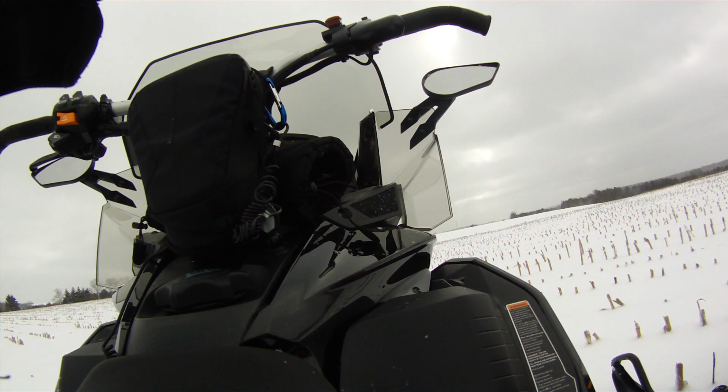So the spring tension, definitely, if I adjust this tension right here or put the block on that, not only does it have the air, but it's still got the block on the bottom to turn it. You know, the 1, 2, 3? You got 4 settings. Well, you got 2 things. You got the red block, which is the coupling. That has nothing to do with preload. That's only got to do with when you hit the gas, it locks it from going down, so it doesn't lift the skis. If you want to lift the skis, you make it soft. You turn that the other way, and what they call it is uncouple. Thank you. Yeah.